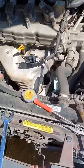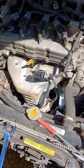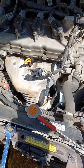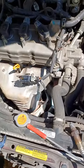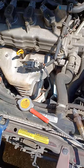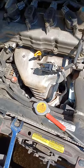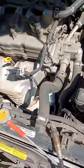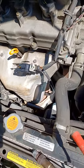Here's how you do this: buy the part at night, drive the car home, and leave it in the garage cooling all overnight. When it's cool, and before you go to bed, spray the penetrating oil on there and get it nice and wet. Make sure it's covered — where it enters the exhaust manifold is where you need to spray it. In the morning, before you get started, spray it again. Make sure you spray where it connects to the exhaust manifold.